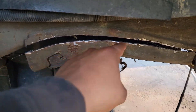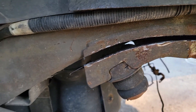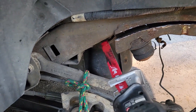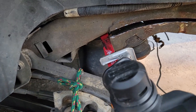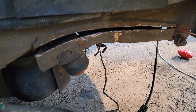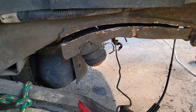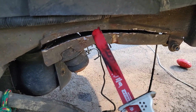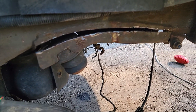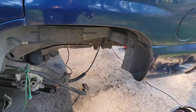I've made a decent gap on the doubler and the frame side. I'm gonna try to get in there with the reciprocating saw — it's got a metal blade obviously. Now keep in mind that's your gas tank over there, so whether you start this way or that way, just be mindful of the gas tank so you don't cut a hole in it. I've seen a few people open this up a little more to gain better access.